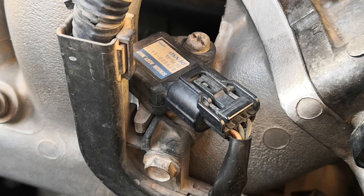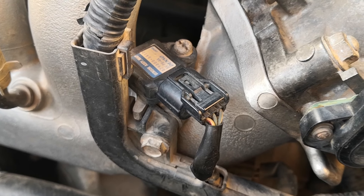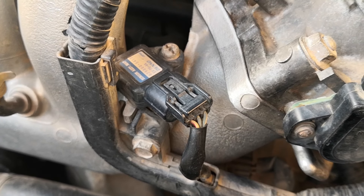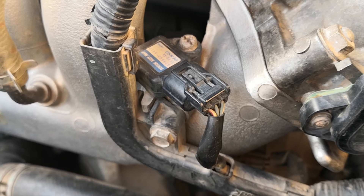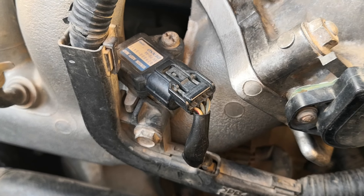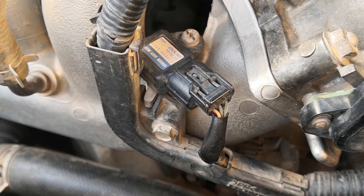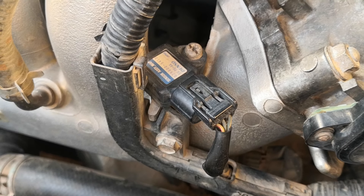The MAP sensor is a critical component of the emission system and there isn't any guidance from most manufacturers on when to clean your MAP sensor, but this is something I try to do as part of a general tune-up. The function of the MAP sensor is to measure the level of vacuum in the intake manifold. The ECM uses this to determine air-fuel ratios. When the MAP sensor is bad or failing, you would have a lot of drivability issues: hard starting, rough idling, stalling, poor gas mileage. You may also have a surging idle and an RPM that bounces all over the place. Some cars like this one are fitted with just a MAP sensor, some are fitted with a MAF sensor, while some have both the MAF and the MAP sensor.